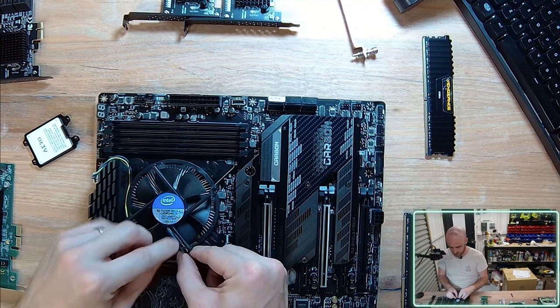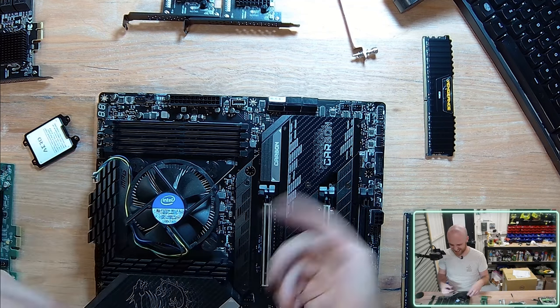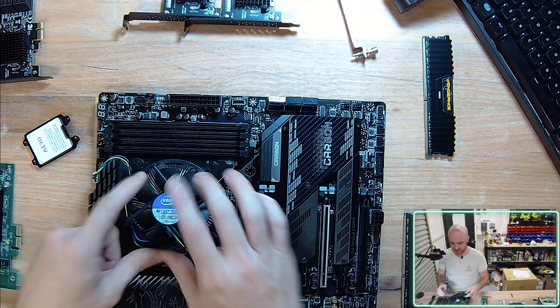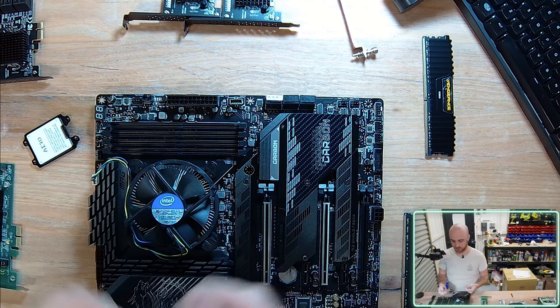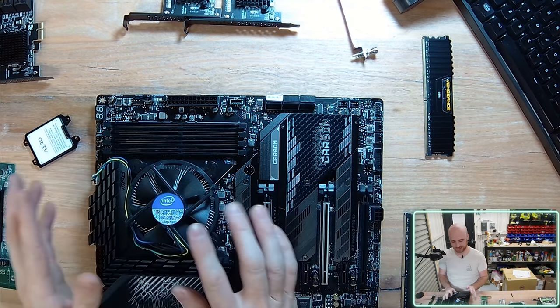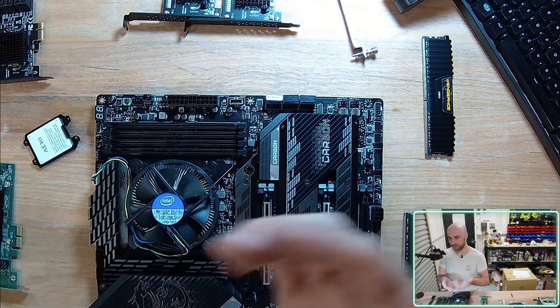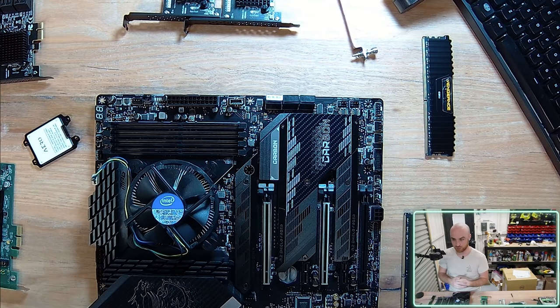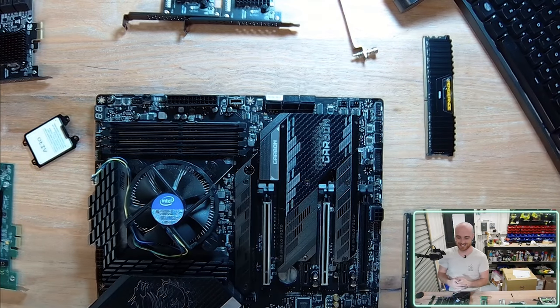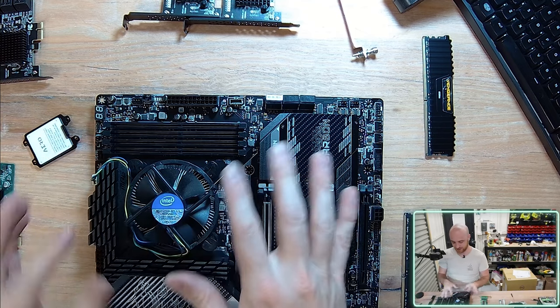So interestingly enough, this CPU fan header is connected to the temperature statistics, so if your temperature is increasing, then the fan speed will automatically elevate. And you can also tune fan performance profiles. You can set your fans to be 100% all the time, or you can have more aggressive profiles that if they detect a little bit of temperature increase, then, you know, blast the fans, or you can have it on like a silent profile where it says, look, I'm happy to sacrifice a bit of temperature and performance and have my CPU get to 60, 70 degrees, but only keep the fans running at 30%, and then as it goes up another 10 degrees, go to 40%. So you can, you know, tune your performance profiles.